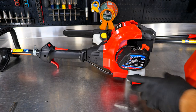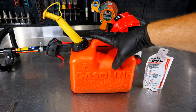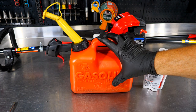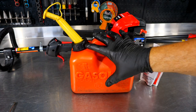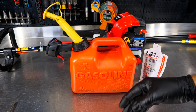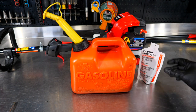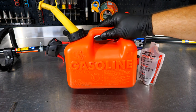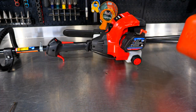Before we do anything, we want to make sure we have the properly mixed fuel. I keep a gallon jug like you see here of mixed fuel. The reason I keep a one-gallon container is because it makes it very easy when I need to refill it — I just get a 3.2 ounce container, dump it in there, put my gallon of fuel in, and the fuel that's going in helps mix the oil. I know I need to add a gallon and that's going to give me the proper mixture. They send a semi-synthetic two-cycle engine oil that you can use — definitely use this to get the proper mix.